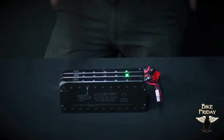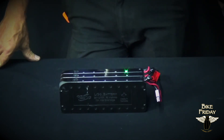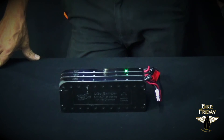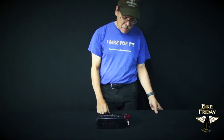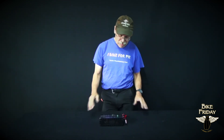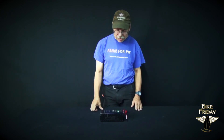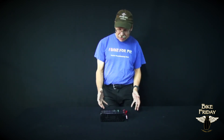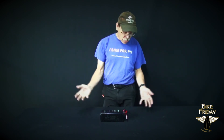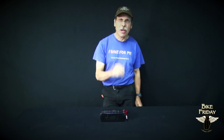That's basically it. The number of phone calls I've gotten from people saying 'hey, my bike's not working' — and I'm like, your bike's working fine, it's your batteries, they're kind of asleep at the switch. That's the one annoying thing about LIGOs, but it's actually a very cool thing because it prevents the batteries from completely depleting themselves, so you can store these batteries for a long period of time and not have any problems. The only problem is you've got to wake them up when you bring them out of storage.